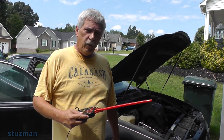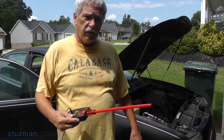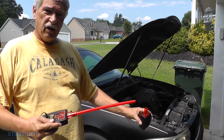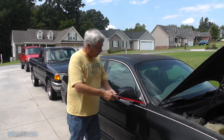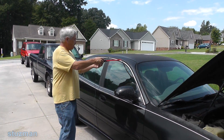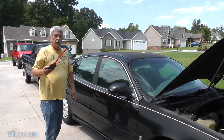As a last test — let's say you've got some weather stripping around your doors or maybe your sunroof. I've had good success finding leaks around sunroofs and finding out exactly where the issue was, or maybe your trunk. This is where the transmitter comes in. Here's the transmitter — it's generating high frequency pulses. You can see it's picking it up. Let's say we want to go around this door and find out if the weather stripping is leaking. We take the transmitter, just sit it in the seat, close the door, and now we just go around the rubber molding. If we start hearing it, then we know we've got a leak in that particular area. You can see right here everything is fine. That's just another example of what you can use an ultrasonic diagnostic tool for.